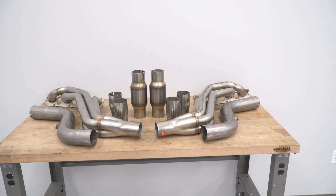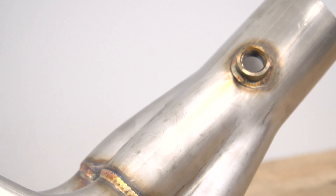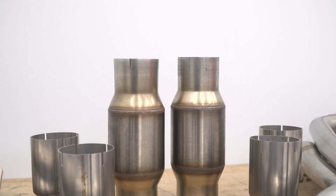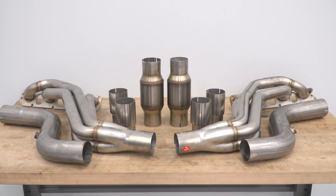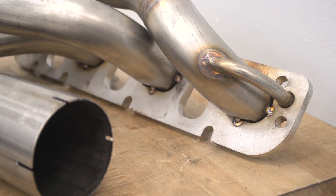With that being said, if you were to have two on the table — one from Stainless Works, one from Stainless Power — I guarantee you'd be very hard-pressed to find the difference between the two. You are still going to find things like TIG welded 304-grade stainless construction throughout. In this case, you're looking at mandrel bent 1 and 7/8-inch primaries, making these a great choice for both naturally aspirated or forced induction applications.